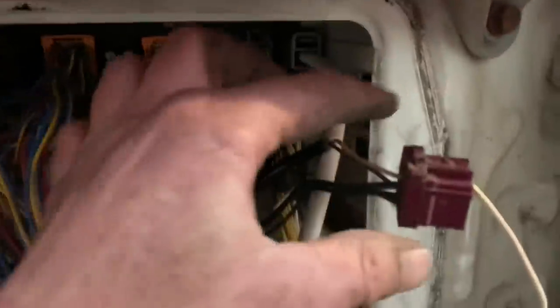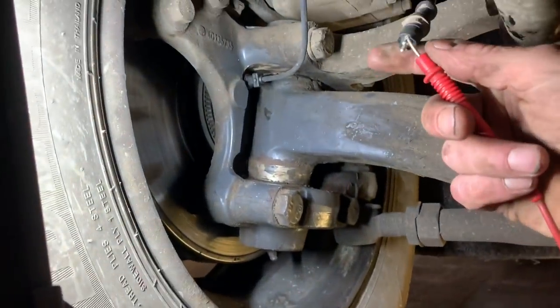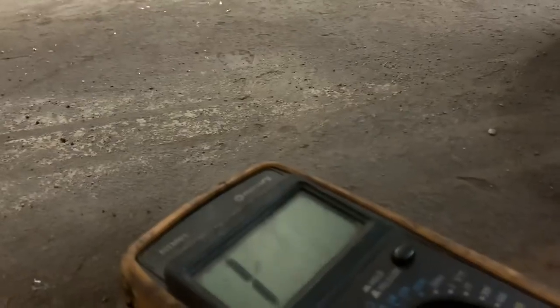I'm going to have to trace that ABS wire. Right, I've sussed that one — that one's the offside one. I've got my wire going into there, disconnected the plug, going on to my multimeter. And if I put my other end of my multimeter — hear it? So we know that ain't got a break in it.